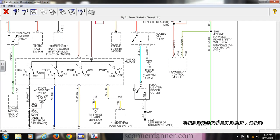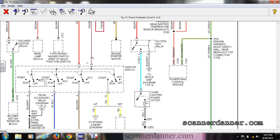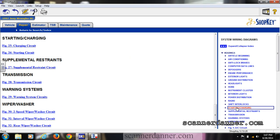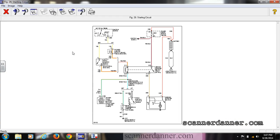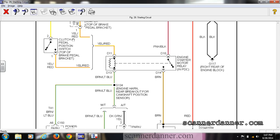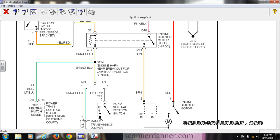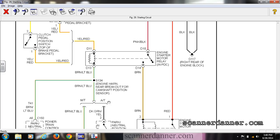I'm back at the diagram. I have no power on the yellow in the crank position, and I have a good feed coming in. When I try to manually energize this circuit back to the starter — taking power on the yellow to the control side of the relay — then going to ground through the park neutral switch, which the garage owner already tested.